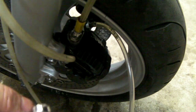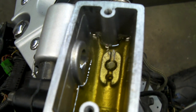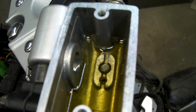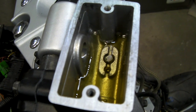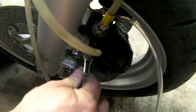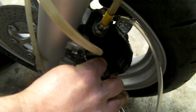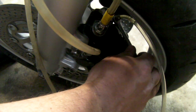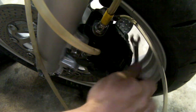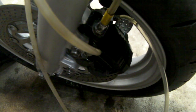This is going to take some time. I'm getting air out of the lines and calipers — I'm starting to get quite a lever now but I need to top up the reservoir. Opening both bleed nipples to check — yes, lots of air there. That's a good sign: we want the air out. Same on that one as well. We'll gravity bleed both for a few seconds, keeping an eye on the fluid level, and let some fluid go through.